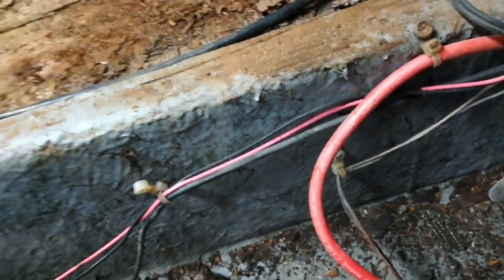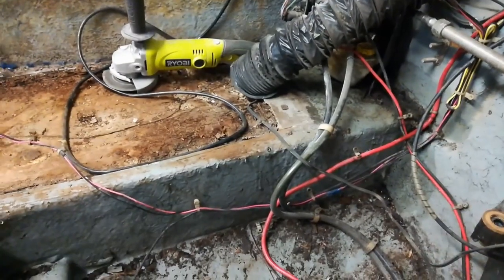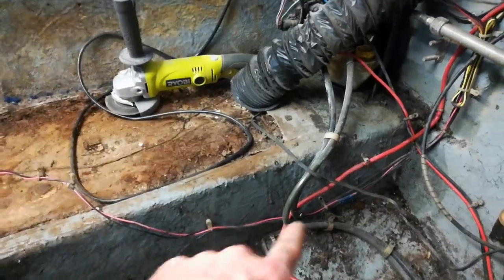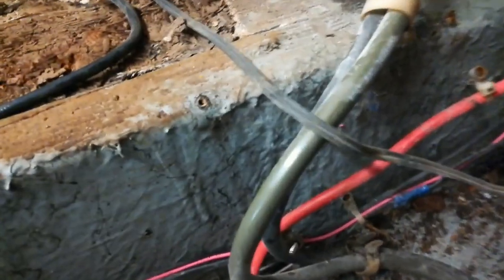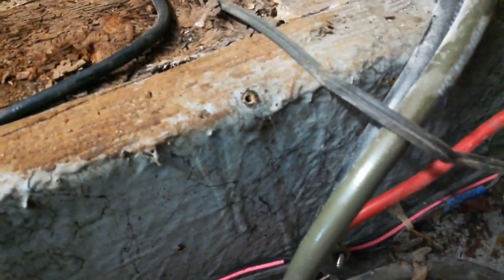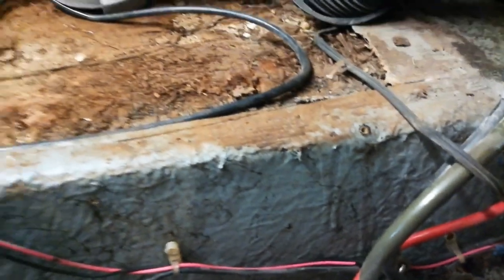I'm thinking I'll probably go with some sort of velcro with an adhesive back so that way you can easily take them off if you ever need to. Just to show you guys how many screws they have holding all those zip ties for the wiring — I just started taking them out and there's already at least 30 right there, and I'm not even done. Every single one of those holes going into the stringer — into wood — is an opportunity for water to get in there and start rotting that wood, and that is exactly what we don't want.